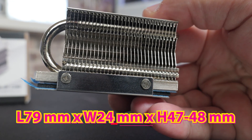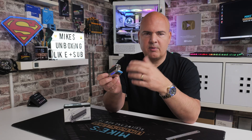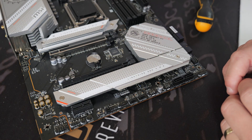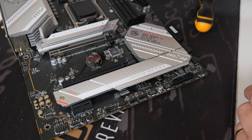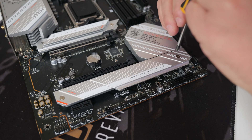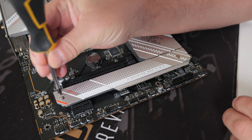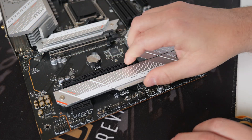When it comes to actually installing it, it's very simple — there are basically four screws, two on each side. Starting with installation on our motherboard, I'm going to leave the primary heatsink intact because it's actually quite a decent chunk on this particular motherboard. The one at the bottom is just a very basic flat piece of metal, so we're going to remove that first. Just undo the screws on top of the heatsink as you would normally for pretty much any motherboard or device.